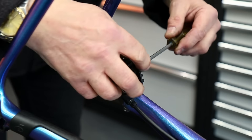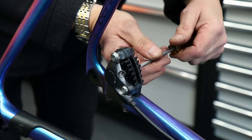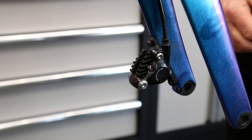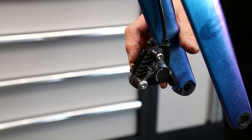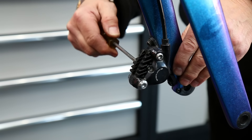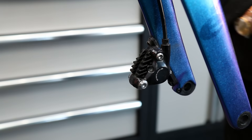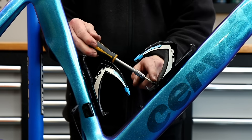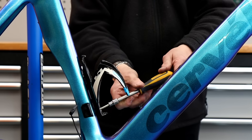We're also going to remove the brake pads. This bike has actually done very very little mileage from the wear that's on it. With disc brakes we need to clean those up - make sure the pads are always clean before we put them back together just so that we prevent any problems with brake noise as they're being ridden.